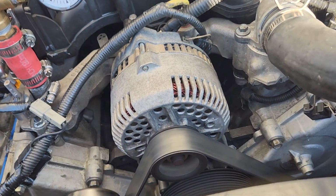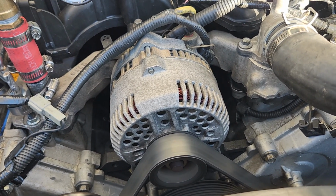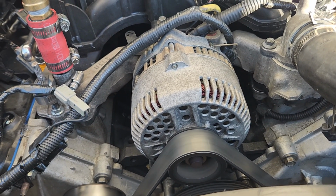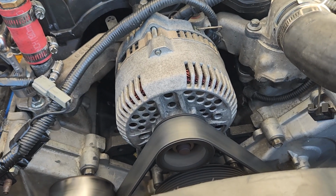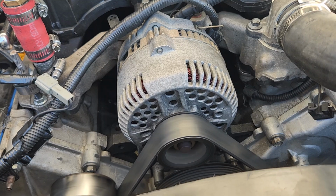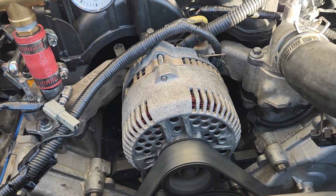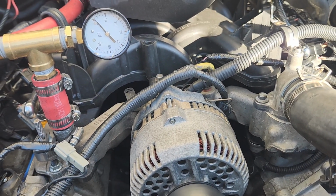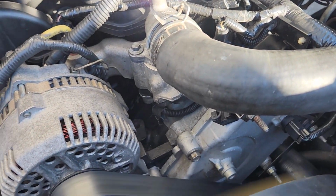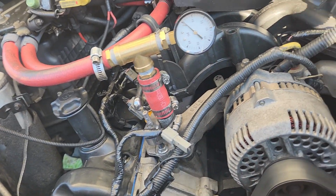And when we were coming back home, while the engine was in dire straits, leaking oil and coolant and compression going into the water jacket, we still seemed to manage about 176, and when I started going above 180, I knew that I was getting low on coolant, so I would stop and add coolant, just to make sure that we got home safely. The truck was running good because I had fixed everything on the road except for the head gaskets.